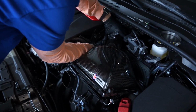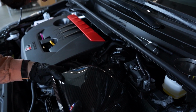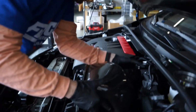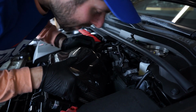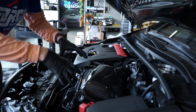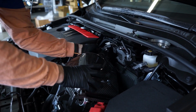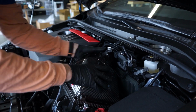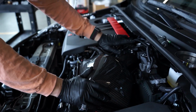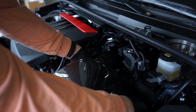First go. As suspected with most of these silicone couplers, it's hanging up a little bit on the bottom. I am just going to slowly rotate this in place as I line the airbox up with the bottom half. And as we start to get this on there and it gets the right angle, it is gonna wanna go and slip on a lot easier. So I'm just gonna move this around a little bit, just rotate it, just make sure that this isn't tensioning it strangely. But so far, it seems like everything is enjoying where it is.